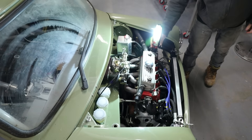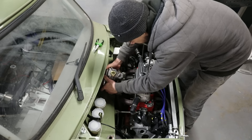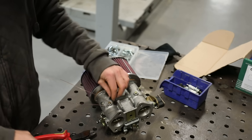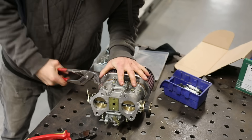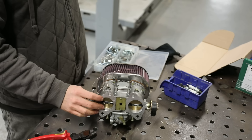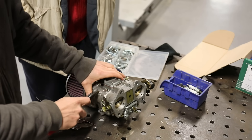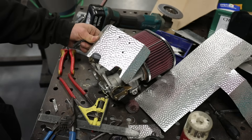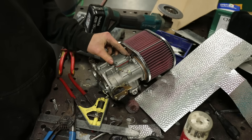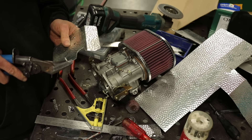So this is back at the workshop. There are a couple of little jobs I just need to sort out before this thing's finished. One of them being that the manifold is fouling on the exhaust — this is a Maniflow inlet and a Maniflow exhaust, so I'm not sure why they're clashing with each other, but they are and need a little bit of attention with the grinder. Neil also experimented with some different sized chokes and we ended up back on the 38mm chokes that it had in it originally. Once the 3.5 inch manifold was on there, the jetting ended up being very similar to where it was previously — the only difference was the air corrector was dropped down to 160 in the end. So the issue was pretty much just the manifold.